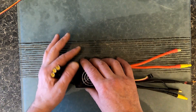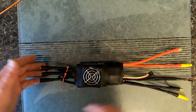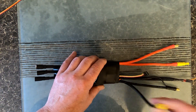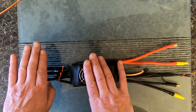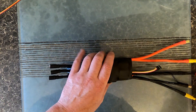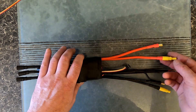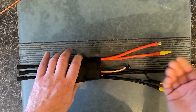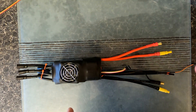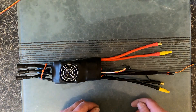There's 600 amp wire — if you want to go that way — and there's no way that'll die before the connector will. I like to go a little bit heavier, because if you get a weak point in the power source coming out or coming in, it'll create resistance. Resistance creates heat, heat means power draw — lots of power. So you want to minimise the amount of resistance going through the whole system. That's the best way.